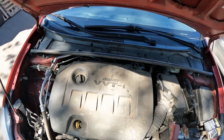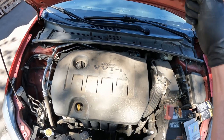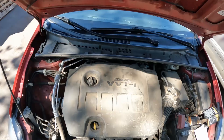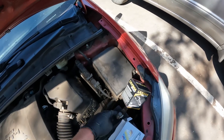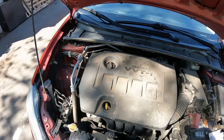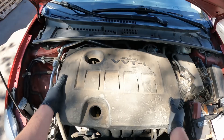What's going on everybody, Grim Repair here. Today we're going to be changing spark plugs on a Toyota Corolla. There'll be links down below to the parts and any special tools needed for the job. If this video helps you out, be sure to give it a like. First thing you're going to do is pop the hood, remove the negative post on the battery just to make sure you don't short anything out — we're going to be working with some electrical. Next we're going to lift this cover off.